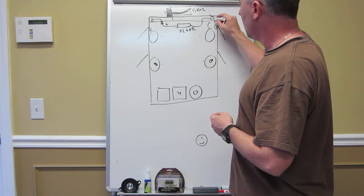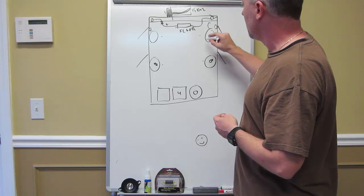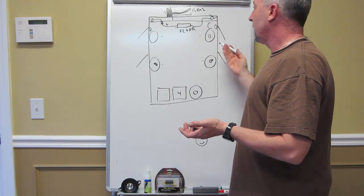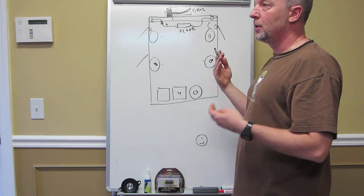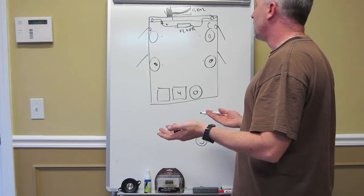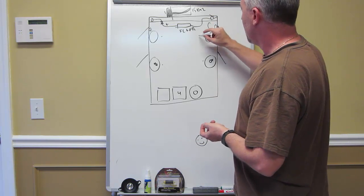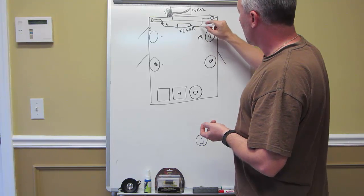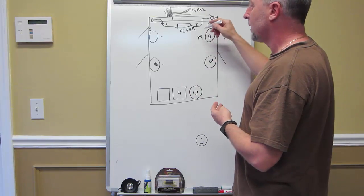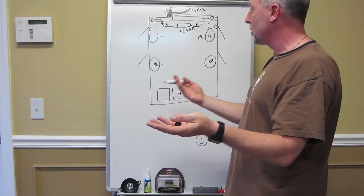They would run at a lower wattage output than these, because these ones here will be running at 120 watts RMS. This one here is running, I don't know, realistically, say, on a 50 watts, with all the other variables, maybe it's running 12 watts RMS. So these speakers here are running at four times as much wattage as these are. So that's good, because you don't want these to get too much power, but you want to get enough to get the effect of the front stage effect. You want that, but you don't want too much.